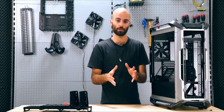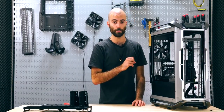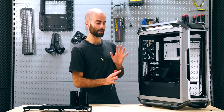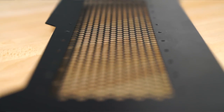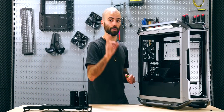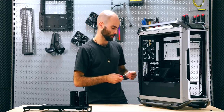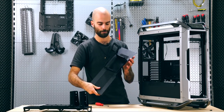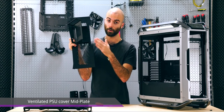These two brackets are secured with screws, and they are the same screws used throughout the whole system, so if you happen to lose them just pick replacements from the included accessory box. The PSU cover mid-plate where the M-port is located is actually detachable — there is one screw in the back, then you slide it out. This gives completely open ventilation, so if you decide to place a radiator in the lower compartment, you don't choke it, and you can still maintain ventilation from the front and top.